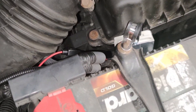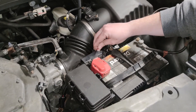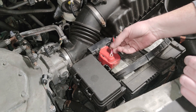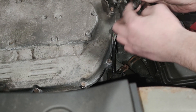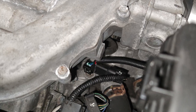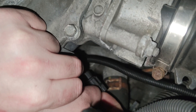Set that right down in there like that, and then take the wing nut and just tighten it down right there. You're going to want to make sure that you keep this red cable up here accessible, because we're going to connect that to the battery after we connect the connectors down below. Where we unplugged this cable before, we're going to take the same end and plug it down into there, and then take the end that we unplugged and plug it into here. It may be easier to connect this to the one that you unplugged before first. Once it's all plugged in, take the piece of Velcro and just secure the wire to the rest of the wire so it's not flopping around in there.